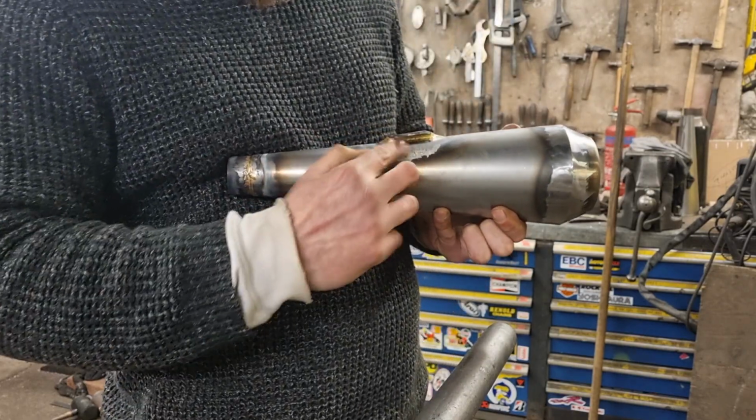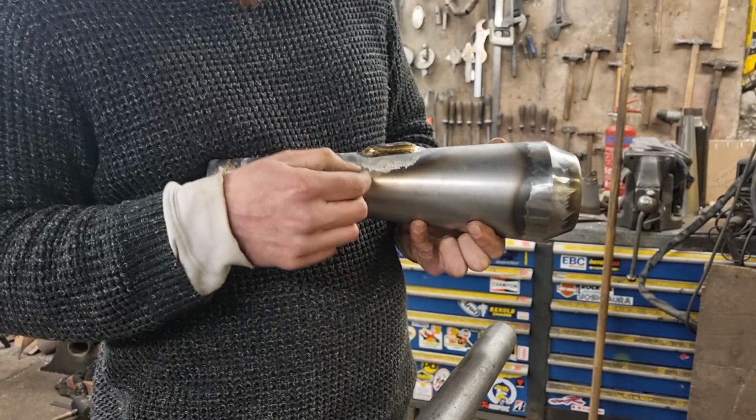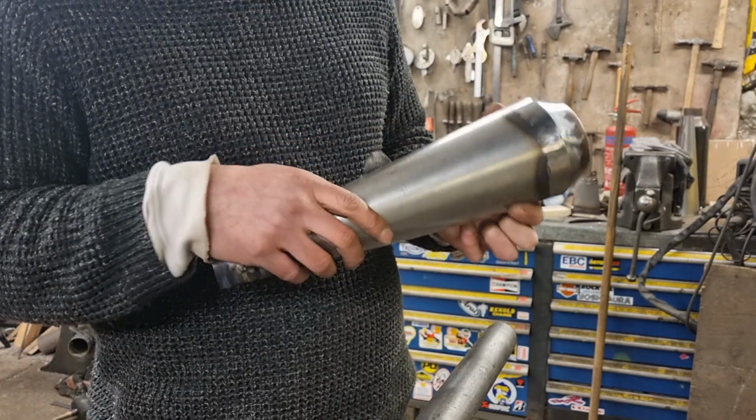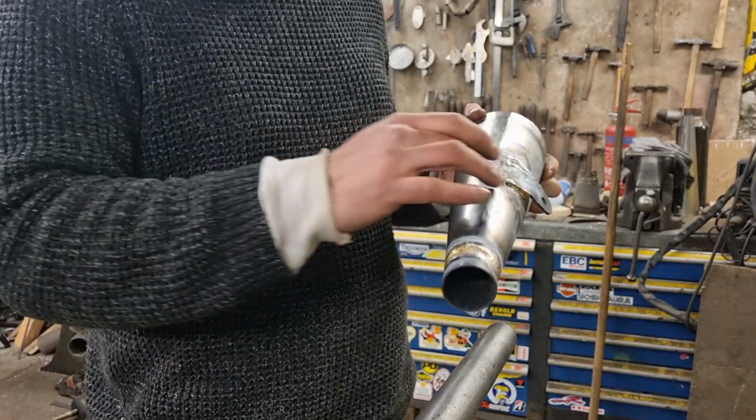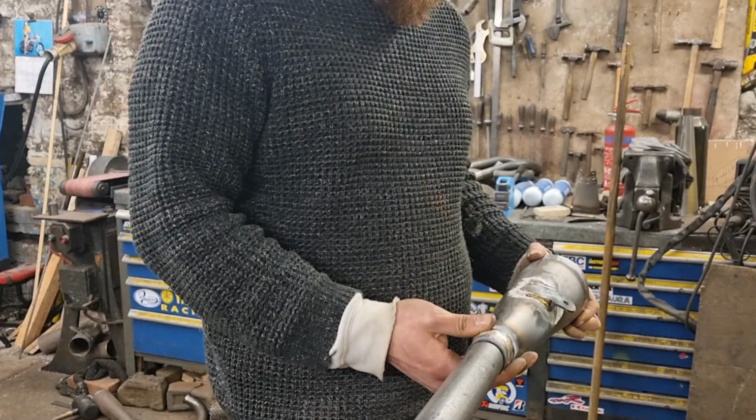in. So yeah, one way of doing it is to warm that up and put a bit of a dint in there so I can drop the bolt in. But I'd rather not, so I'll try a different bolt in it first. So what I'm going to do is braze around that. Then I'll braze around the pipes. And then we'll have a look at that.